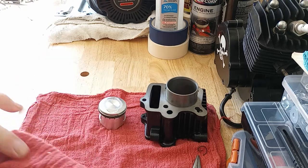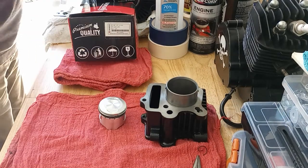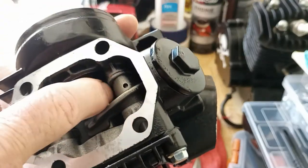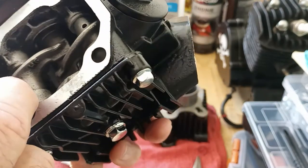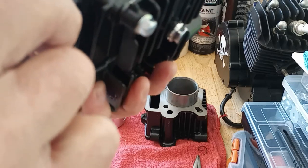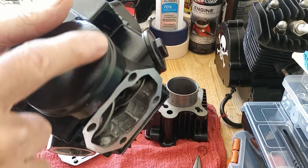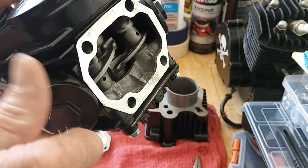Let me show you also what you might want to do on your head — with your valves, cam lobes, and tappets. You'll want to put some assembly lube on your cam where it's going to lift your lifters, your rocker arms, and pop your caps off and put some on those tappets and valve springs. Just dribble this stuff in there a little bit — it mixes with oil. Put a little in your oil holes too. Same thing when you do your timing chain — put a little on that gear and on that chain so when you fire this thing up it's not dry until the oil pumps up there.